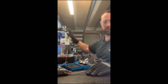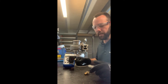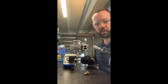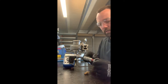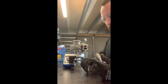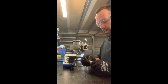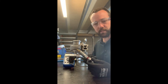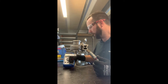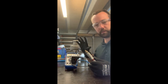The reason we utilise these is that it has very fine tolerances and reading capability, which is crucial when dealing with wastegates. One important step when utilising a pressure transducer and multimeter configuration is ensuring that we've zeroed out the sensor. I'm utilising a CompiCheck fitting which, when resting, seals off the sensor and doesn't expose it to atmospheric conditions. To zero it, I'm using a dummy fitting which, when applied to the CompiCheck fitting, exposes the sensor to atmospheric conditions — then we can adjust the pressure transducer to zero it. You'll see here on the multimeter, I've zeroed this out and it's now ready to use.